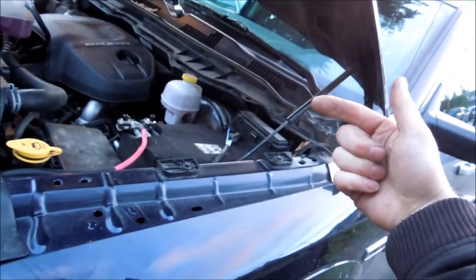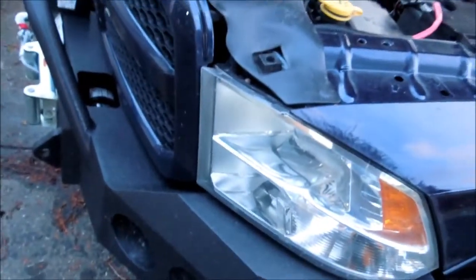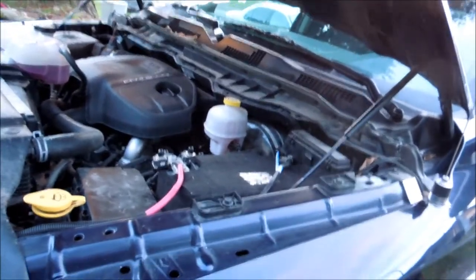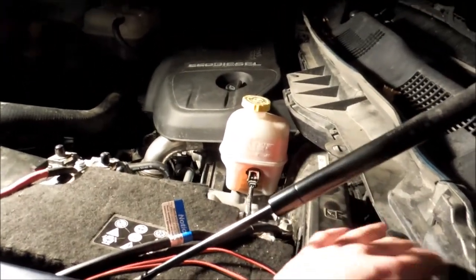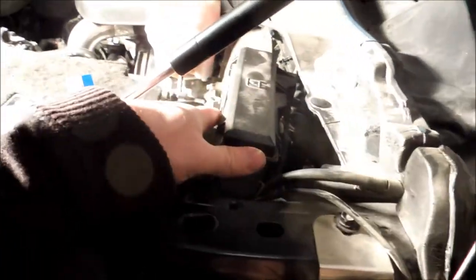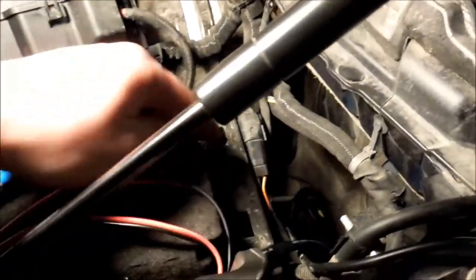I've already figured out the routing. You know the big wire grommet that's currently inside your vehicle? We're going to use that existing grommet to run our wires out. On the Ram 1500, if you're trying to hide these lights, you're going to grab onto the fuse box right here, pull it towards you away from the truck, and once you do that, you'll lift it out. See how there are these two hooks on the bottom? That's what's holding it in — there's one here and one on the bottom. And then if you look inside the hole, you'll see I have a grommet popped out down here.